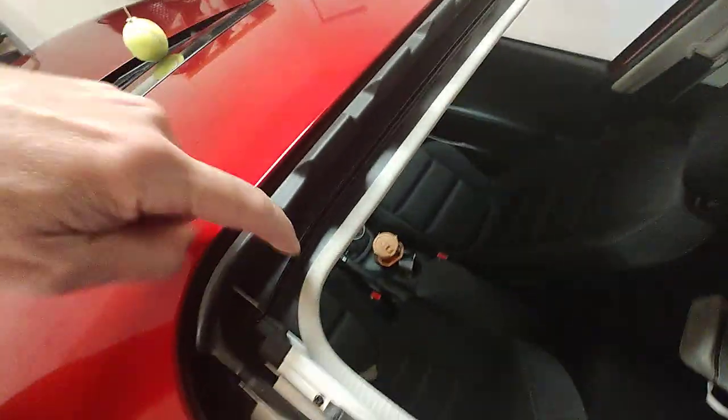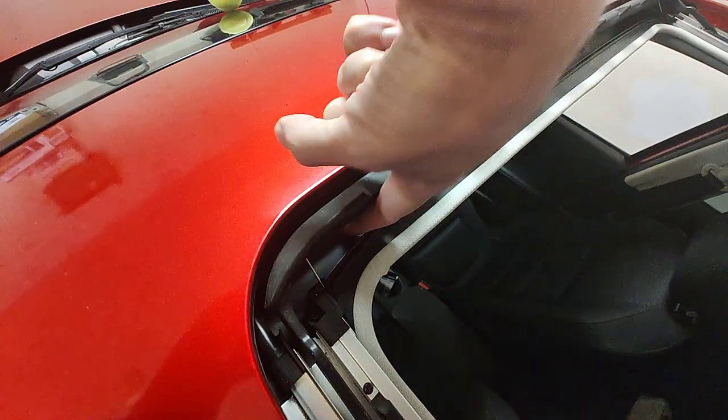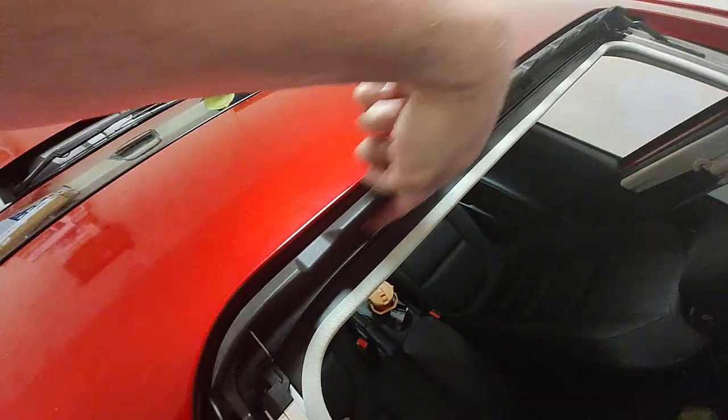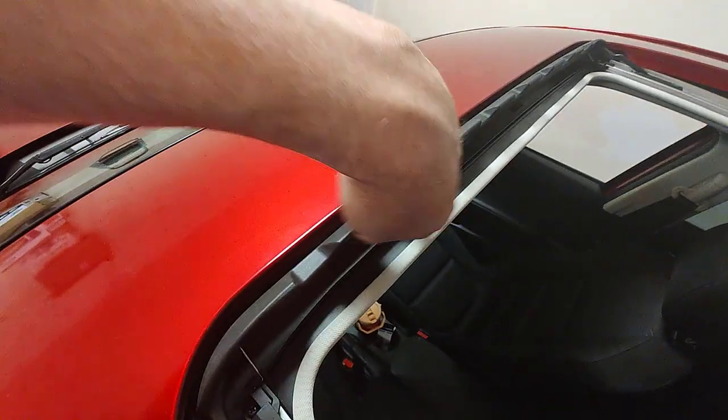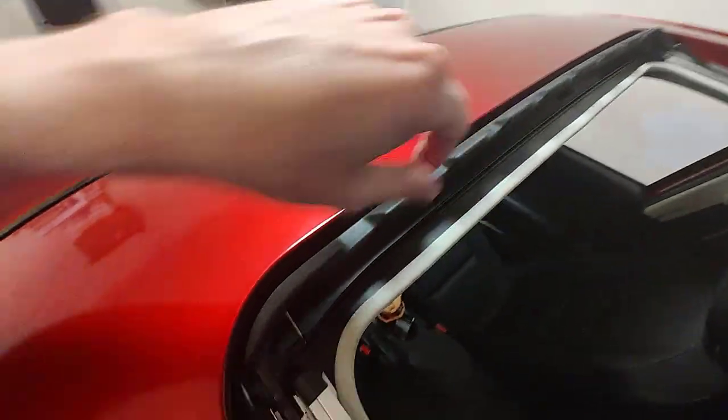So here's the problem, and what causes this is that this tray, this is the tray in here, is intended to be able to have water in it. To have a leak, and then it's tilted a little bit or molded to this side and molded to the other side, and then to run out these drains. So I've already cleaned out this tray. You could probably see some debris in the corners.